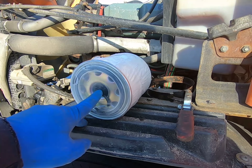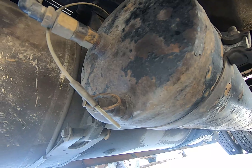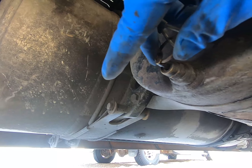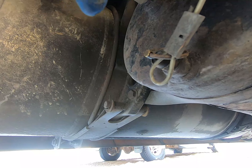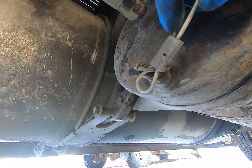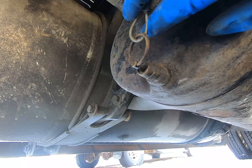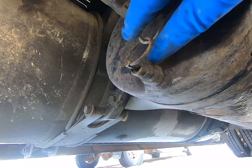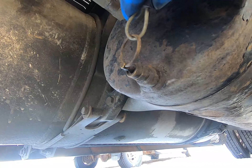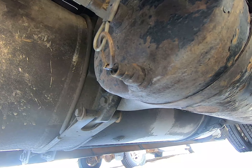All right, we're under the truck now. One thing to check — on your air tanks here, just give the pull and try to bleed the air on your finger to make sure it came out nice and dry with no oil. You want to make sure you don't have oil or excessive moisture in your air tanks. I mentioned in my winterizing video that I'll sometimes pull the plug before winter to check for water — this one's nice and dry. You should be draining these daily while you're fueling the truck or walking around doing your pre-trip.